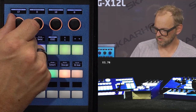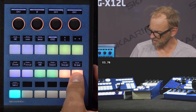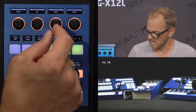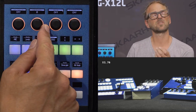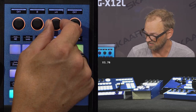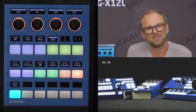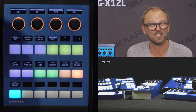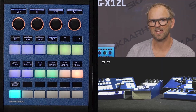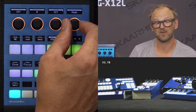These dimensions are available — I don't want to spend too much time on them. In advanced image, we have auto-saturate, edge enhancement which would be sharpness, and sense-up, which relates to some digital exposure features. The point is we have really special features in this camera mapped out onto our Visca controllers — noise reduction on/off is also available here in various levels, pretty standard with three levels seen in many Visca cameras.